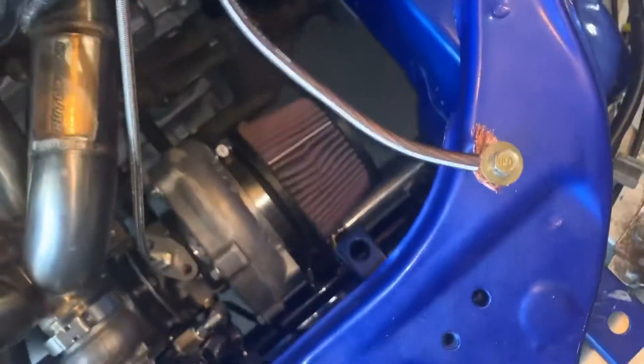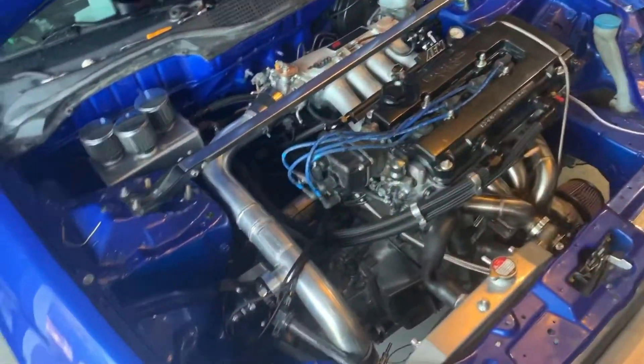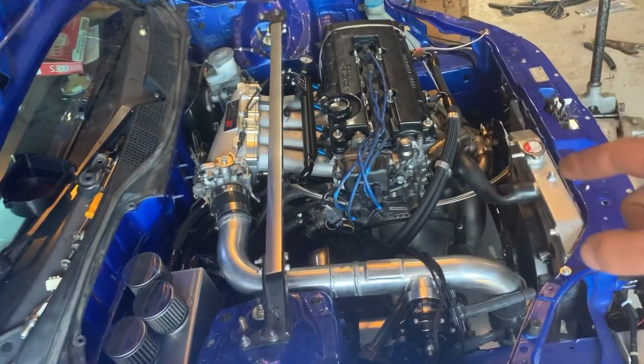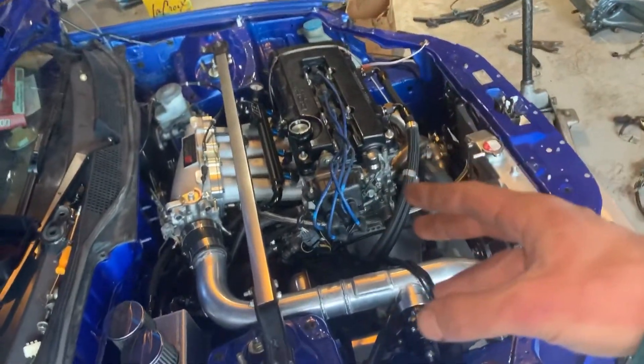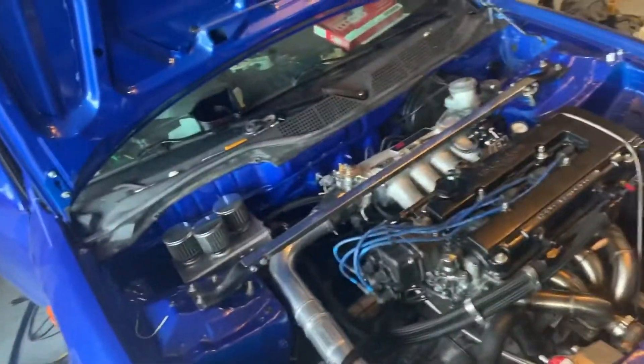You guys like my ground? Is that a good ground? Alright, so let me tell you — coil-on-plug situation, all that didn't work. I put my stock distributor back. I reverted the distributor back to stock because I took out the ICM and the coil and some wires and all that. Travis lent me his distributor jumper harness. I have distributor guts everywhere — distributor parts, distributor caps. I put my thing back to stock and it worked!